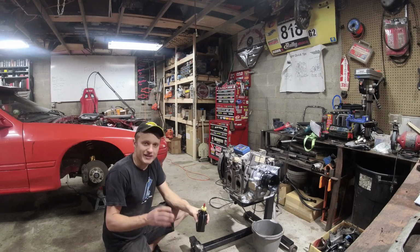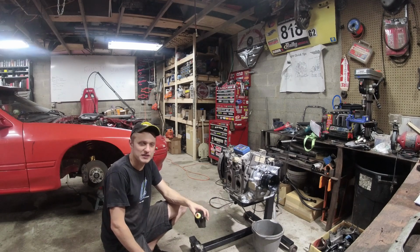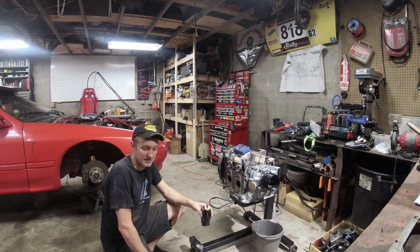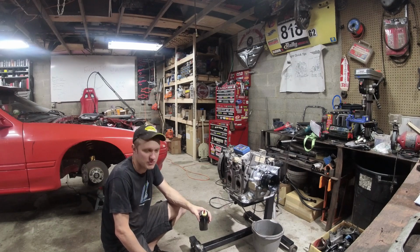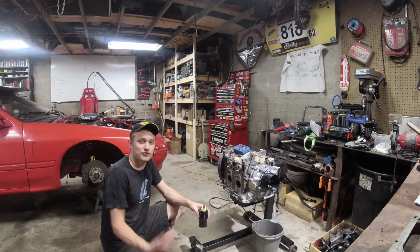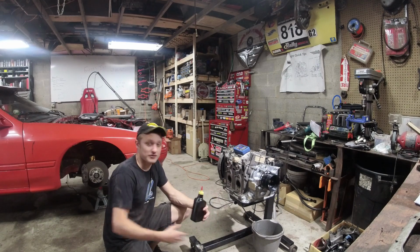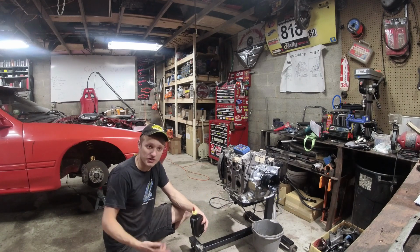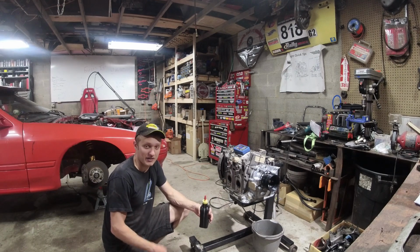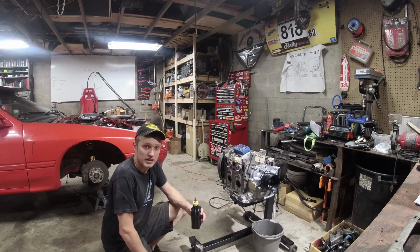The reason that I want to do this, in addition to just learning new things, is a lot of times when you take your rotary engine car to the dealership because it has hot start problems or cold start problems or whatever, most of the time when you have a car that won't hot start, it is very easy to flood that engine. What that is, is that you have effectively coated the whole inside in fuel because you're cranking it so much, you're not burning the fuel, your spark plugs get covered in fuel, they get fouled, and now the car won't start without tow starting it, doing a deflood procedure, and whatnot.